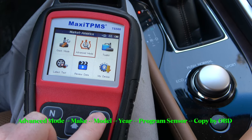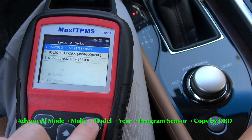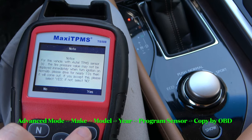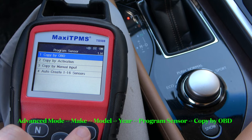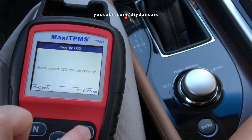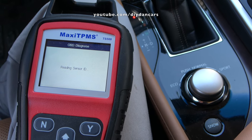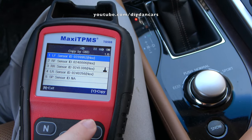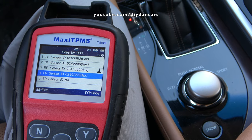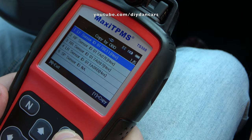With the car in accessory mode and my TS508 connected to the car's OBD port, I'm now ready to retrieve the TPMS sensor's unique IDs from the car's computer. I do this by going to Advanced Mode, selecting my make — Lexus — selecting model — GS — and then the year and frequency type, which for me is 2013 and 315 MHz. On the next menu, I select Program Sensor and hit Yes on the note that pops up, which tells you the sensors won't activate until the car is in motion. On the next screen, select Copy by OBD. If a message pops up saying 'Use data stored previously from ECU,' select No. This forces the tool to download the latest unique sensor IDs stored in the car's computer. Once downloaded, the unique IDs are listed on the right-hand side of the screen followed by the word 'hex.' You then insert the blank sensor into the holder, select the wheel you want to program, and hit copy.